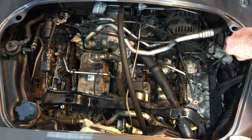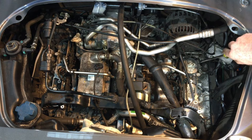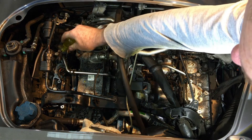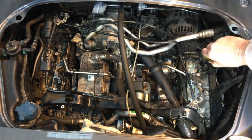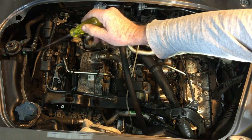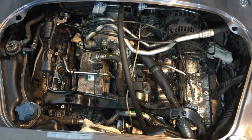If you want to check the oil pressure, there are 2 ports — one on each side. They say to use the one on this side because it's more easily accessible, since there's not much gap when the intake manifold is in and there's no coolant in the way.